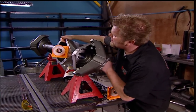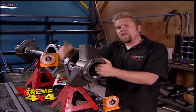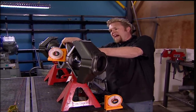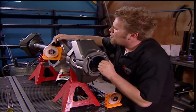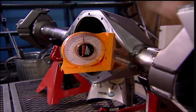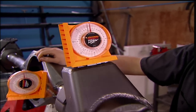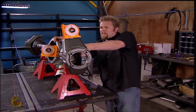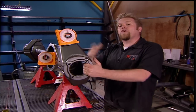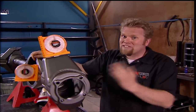With the housing cut to length and the C's slid onto the tubes, we need to set the caster angle. Caster is the relationship between the upper and lower ball joint and true vertical — we want about 3 to 5 degrees of positive caster, or leaning back of the knuckle. To check this, we'll set our third member mounting flange at 10 degrees up to lessen the pinion angle for the front, then drop another angle finder on top of the knuckle to chase down 3 to 5 degrees of lean back. This will help the truck when driving — helping the tires return to center, and also removing any death wobble. Return to center means let go of the steering wheel and the wheels come back to straight, just like on a shopping cart. Death wobble — we've all had that shopping cart with the crazy caster, and you don't want your wheels doing that.